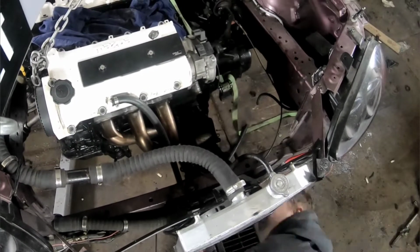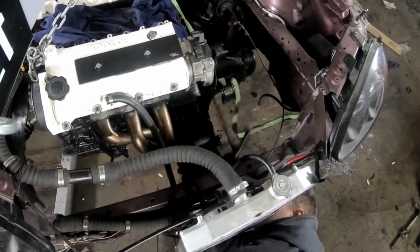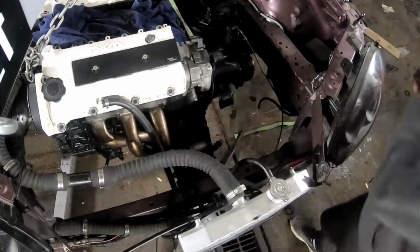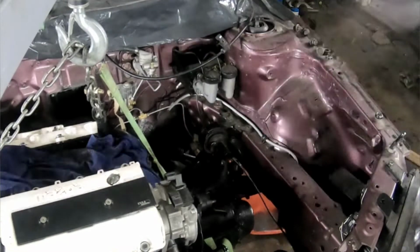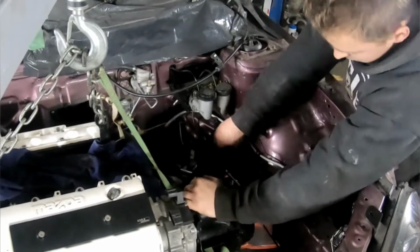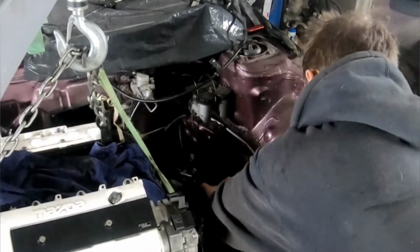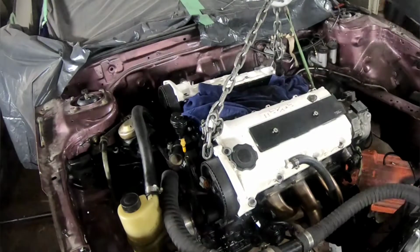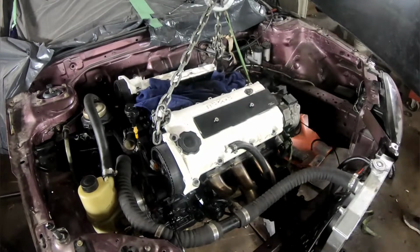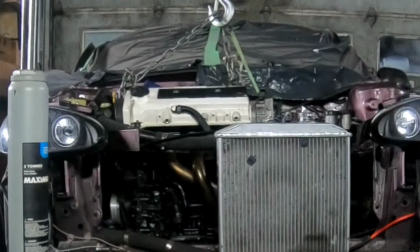When I'm feeding it from the bottom, I'm usually trying to get my cross member in first, which I'm doing right now underneath the vehicle. I get them in about 2-3 full turns and leave it. Don't tighten anything, and then go to the other mounts and just get them into the hole. After a few minutes here, got them all in 2 to 3 turns. Now I'm just underneath, impacting them all in, getting them torqued, all that good stuff.